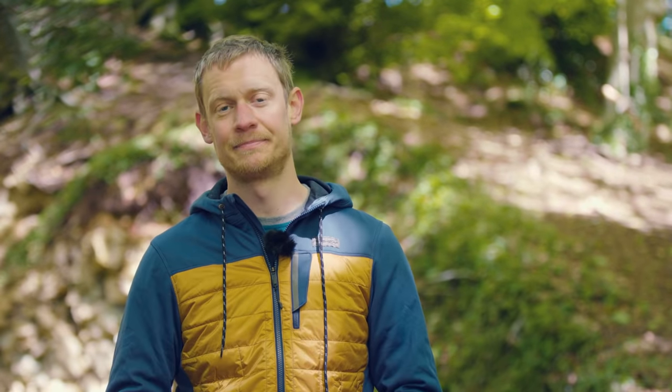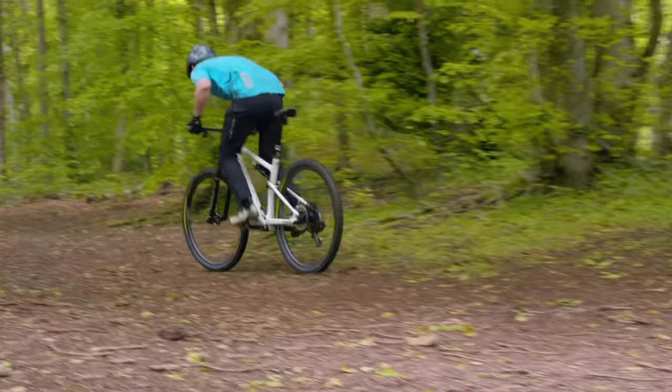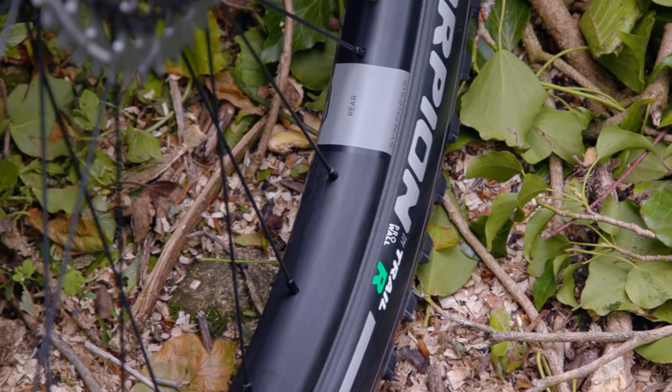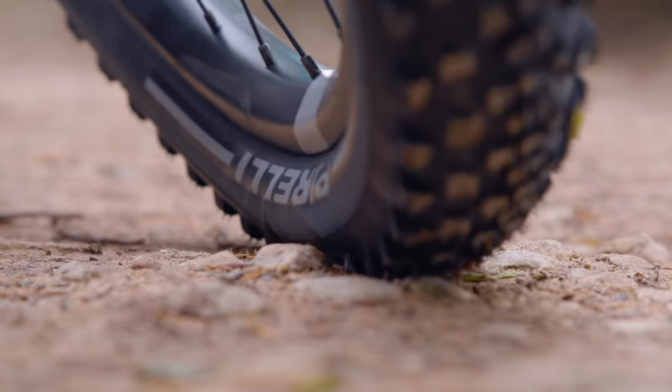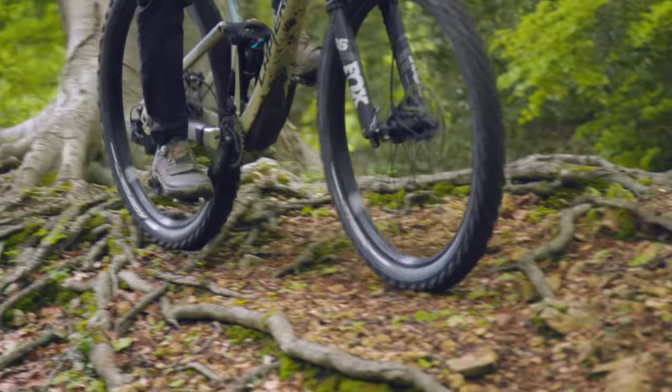Now let's look at the tyres themselves. First up is the obvious one: the width of the tyre. This relates to the overall shape and volume of the tyre, which is also dependent on the internal width of the rim. A wider tyre will have a larger volume of air inside it. Likewise, a given tyre on a wider rim will inflate wider than the same tyre on a narrower rim. A larger volume tyre can handle lower pressures before it feels imprecise or there's excessive movement of the tyre on the rim, or before it becomes susceptible to punctures or burping — whereby the bead of the tyre pulls away briefly from the rim, expelling air. Running a higher volume tyre at too high a pressure makes it more likely to feel pingy and skittery. Generally, a higher volume tyre can be run at slightly lower pressures than a lower volume setup.